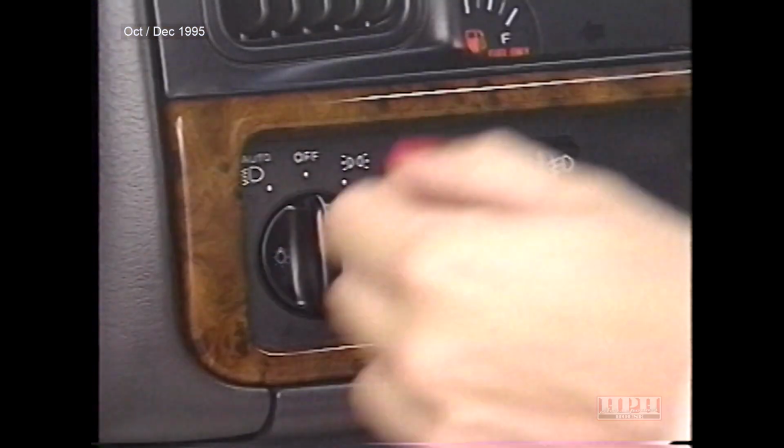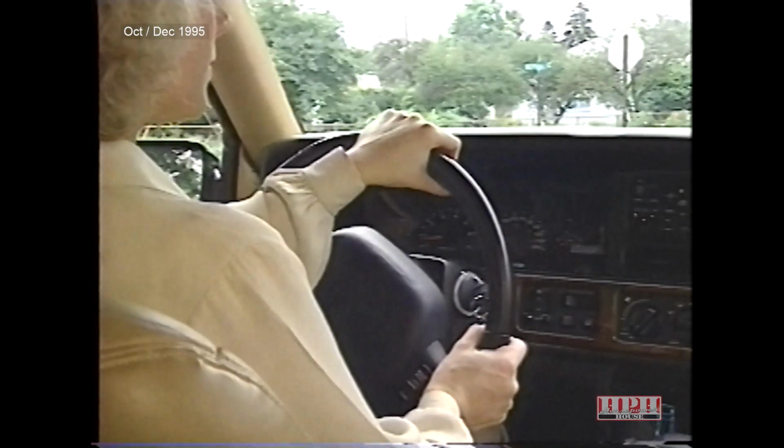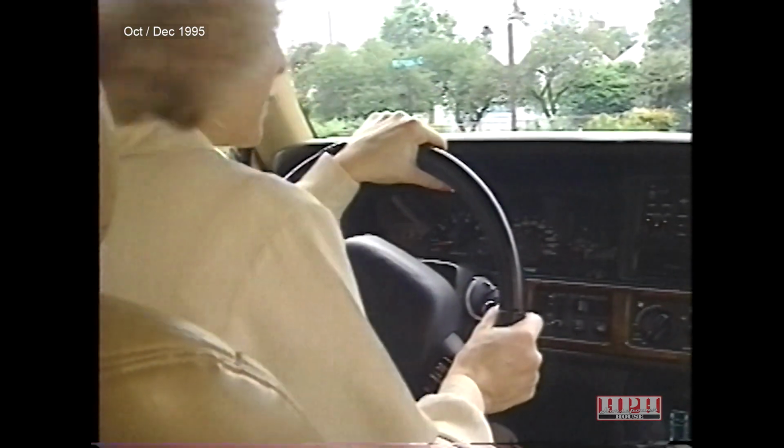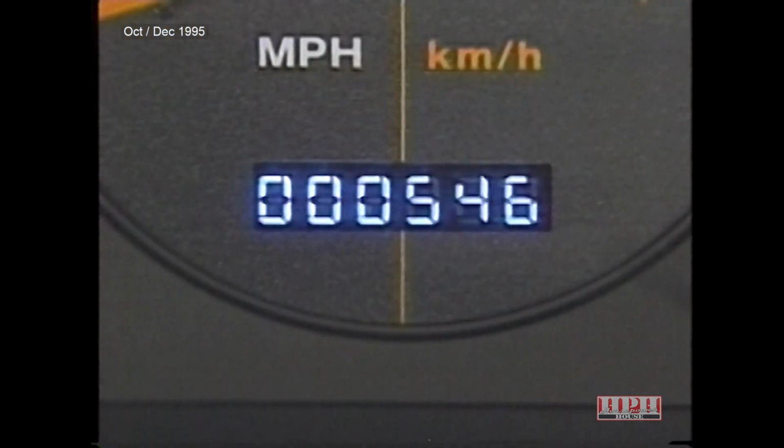Auto headlamps include a new feature called Auto Parade or Funeral Mode. When the park lamps or headlamps are manually activated during the daytime, all of the vacuum fluorescent displays will remain at full daytime brightness to allow for greater visibility. This feature does not affect the incandescent lighting levels.